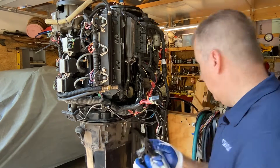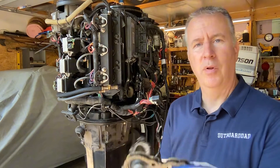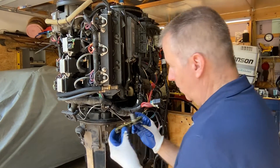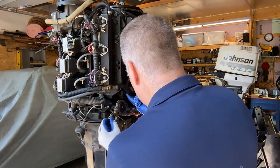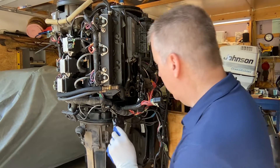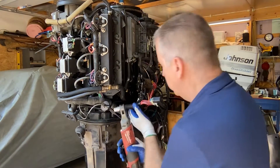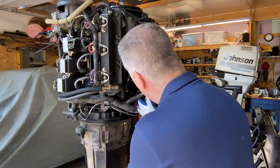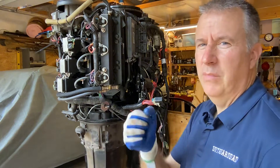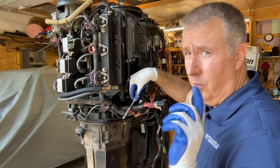We're gonna go ahead and put our cover on, which we've all cleaned up. That cover goes on and then our bolts will go in there. I've got some sealer on this now, so I'm gonna stick it in place so it stays. Now that our poppet valve is stuck in place and we've got a little bit of sealer on the cover, we're gonna put that in place too and put our bolts in. Now we tighten up our bolts evenly. Then I like to come in with a hand ratchet and make sure they're all good. Remember I'm compressing a cork gasket so I don't want to overtighten.